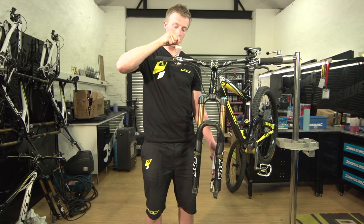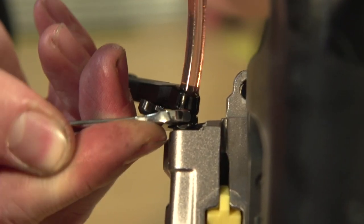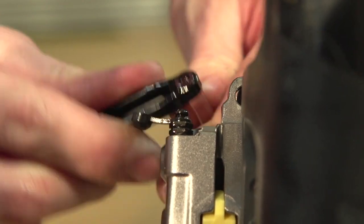Place the plug back in the top, locking your system off down the bottom without over-tightening, then remove the syringe and wipe off any excess fluid which might have dripped out.